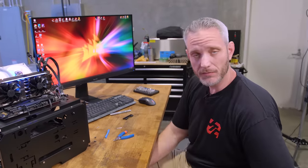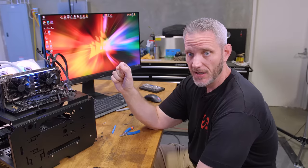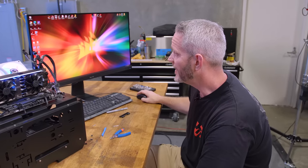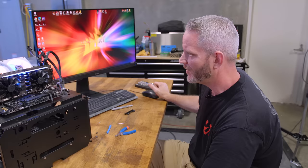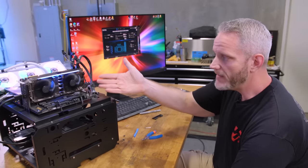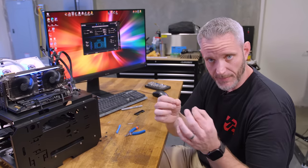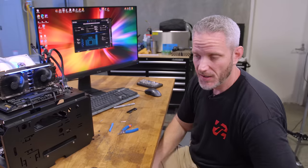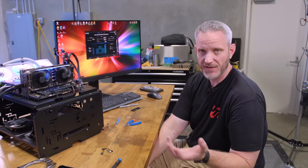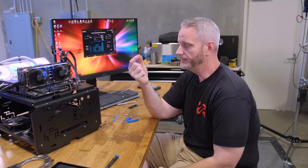It just broke sitting there static, clamped down, not moving. It probably has to do with constant heat cycling — the warm air going through, especially during zero dB mode when the fans aren't spinning, causes the wire to expand and contract repeatedly until it breaks. This is actually why I personally never run fans in zero dB mode. I prefer setting them to around 30% minimum — you'll never hear them, but you keep airflow going and keep components cooler, avoiding exactly this kind of thermal stress on the wiring.